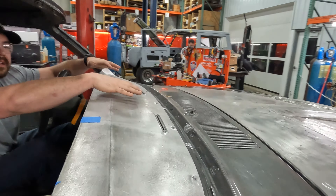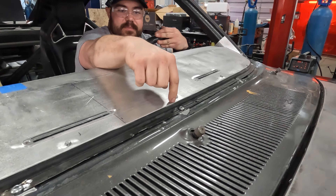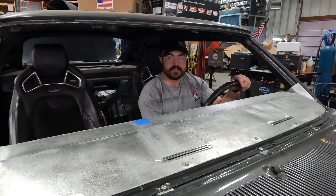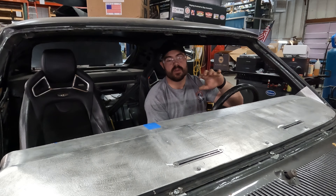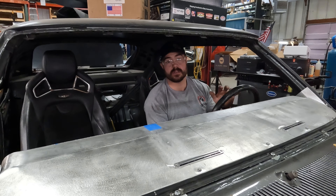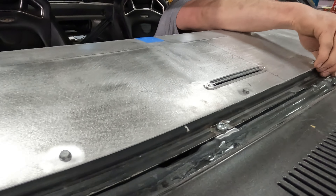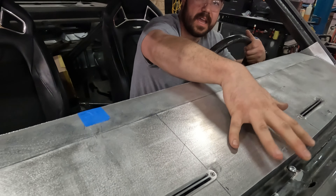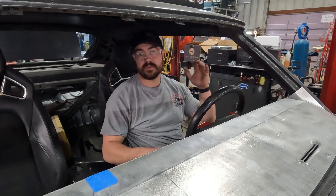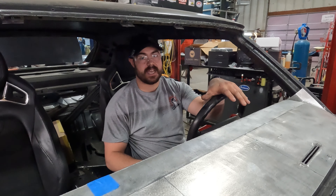All of this will be leather wrapped up top, padded. We've got our defrost vents and the factory front edge of the 69 Charger dash here, which keeps this complex shape and how it attaches to the windshield. We did change how the front of the dash attaches — originally in these cars you had to remove the windshield to get the dash out, which could cause issues if we ever need to service the aftermarket components. So all of these bolts you can see lined across here are just locating pins; the dash is able to slide back and out through other mounting locations on the sides and underneath, so even with the windshield in, you can still pull this dash out.